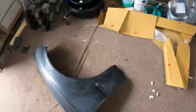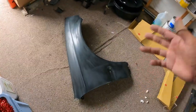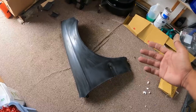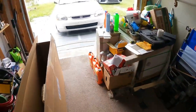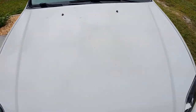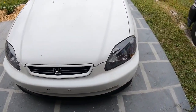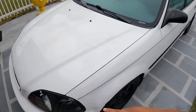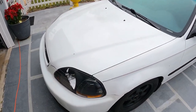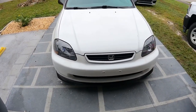Got a fresh one in there. Right now I'm currently sanding this, getting ready to spray some primer here in a bit. Then I'm gonna sand that one and then we're gonna paint it and see how it comes out. From there I'm probably gonna start the whole front end. I don't think I'm gonna do it today because I'm gonna have to sand this hood down — this hood has a lot of little scratches. Get rid of all the imperfections, prime the bumper, put the fenders back on, and do another coat. That's probably either gonna be tomorrow or next week.